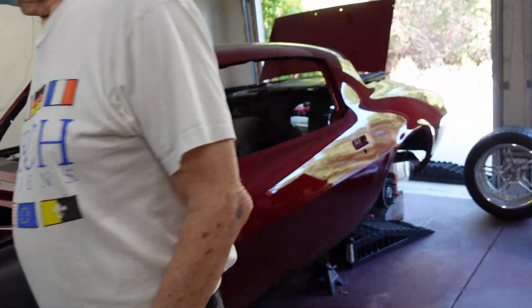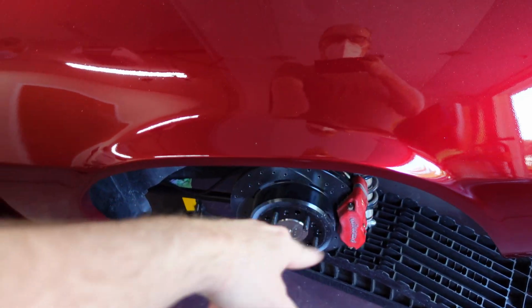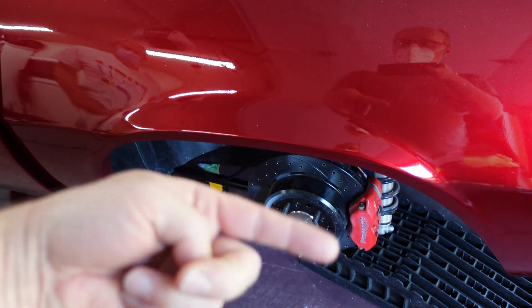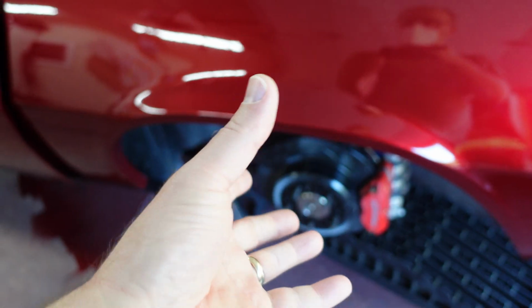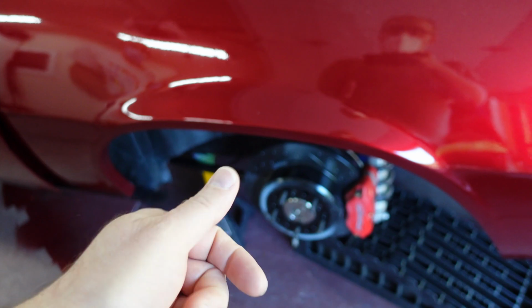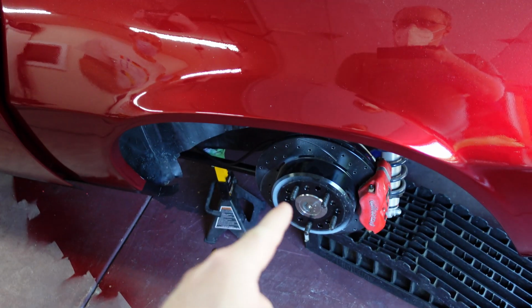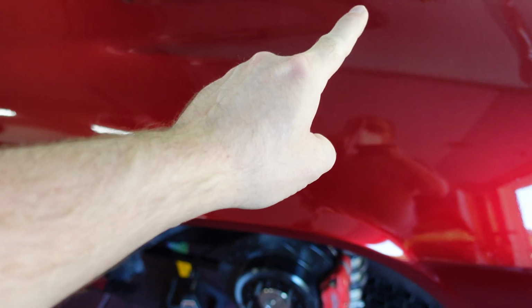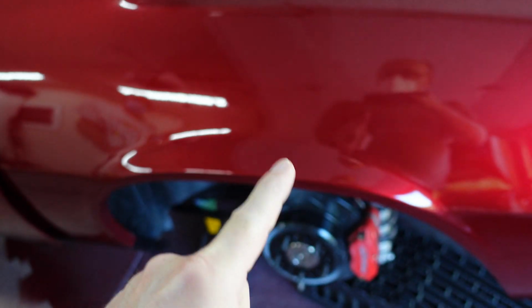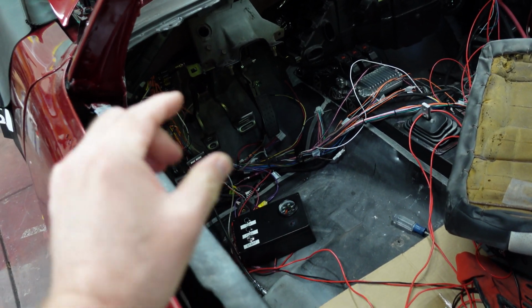So thanks for all your comments, everybody. I went through and dug up the instructions on these things yesterday for the parking brake, and then remembered there was one of those star adjusters. So we have to do that. The instructions are a little confusing because they say turn the wheel until you feel a slight drag. Well, this is on an axle, so as soon as I feel a slight drag on this side, I'm going to feel it on the other side too. So how do I go adjust the other side? What we're going to do, we've engaged the parking brake like 2 clicks, so it's just a little bit engaged, and then we'll do that procedure.